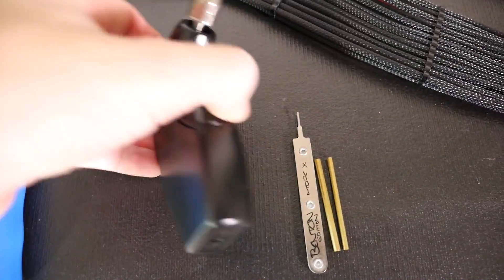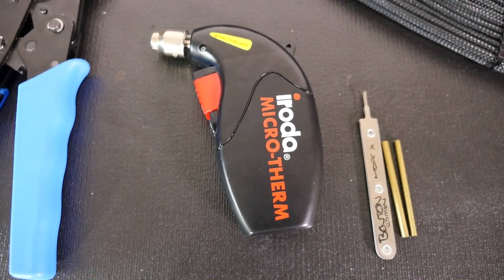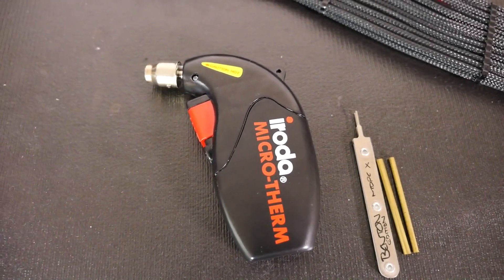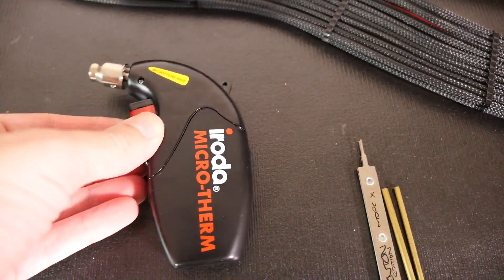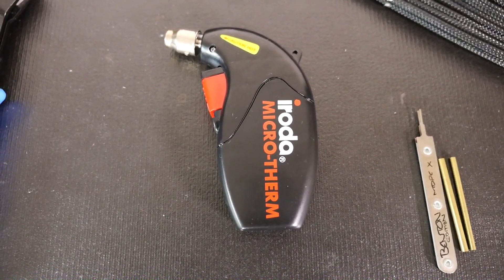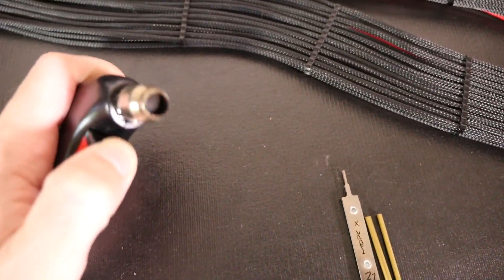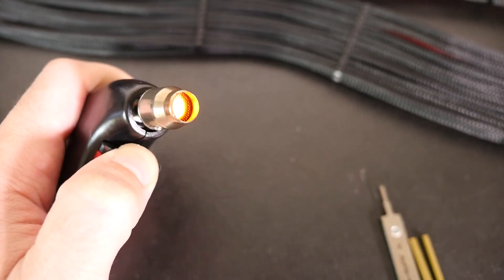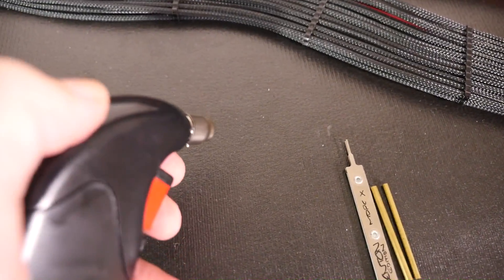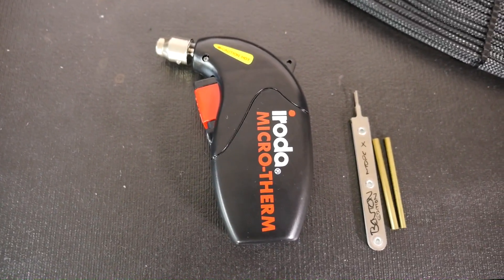Now the burner — a lot of old elite sleevers use naked flame cigarette lighters, and that's where I started. But about five years ago I started looking for something with more control and accuracy that was also safe to use inside a case. Often I'm up in a corner trying to heat shrink and with a naked flame you end up burning off the paint and running into trouble. This tool is specifically designed for heat shrink — it's refillable, will last for years, and has a lighter casing inside. You can control both the heat output and the exact direction of heat, which is very useful. I highly recommend one of these, mainly for beginners.